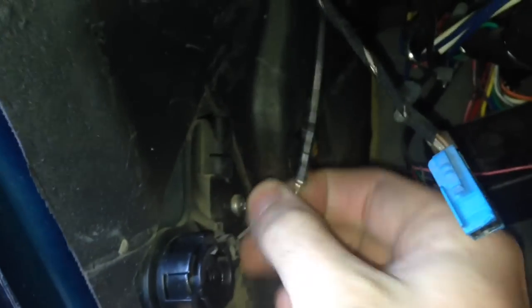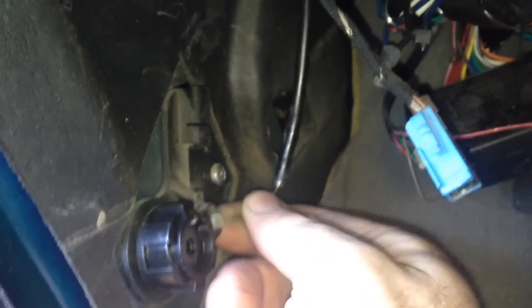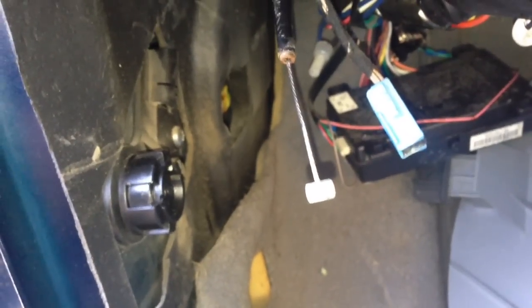I had to get a pair of pliers to do it. You can see up in here — I pulled this out with the pliers, it's loose now. That goes in that lock — you just pull straight up on it and it pops out. To get the slug out, you just go down to where the slot is open and pull it out like that. That's how you do the inside cable.